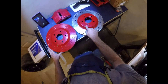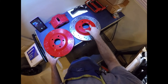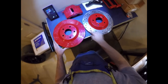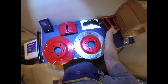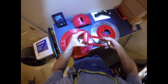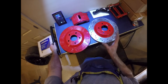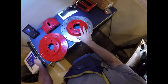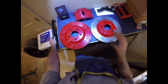The big problem is right here on the cup — there's an offset difference. This rotor is actually for the C5, and this one's for the C4, but there's actually about a 400 thousandths difference in offset. What happened was using the standard one on my C4, even though guys had said it would work, it actually rubbed — it was too far back on the bracket, the caliper bracket, where it rubbed. I don't know if I was doing something wrong or needed a spacer. So one thing you want to do is, before you tear your car apart, mock it up and see how it works, because I quickly found out that without doing something different with the rotor, I wasn't going to be able to use the 13 inch.